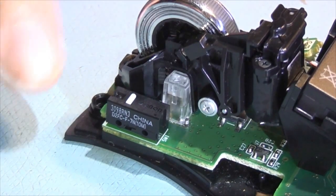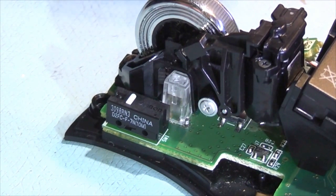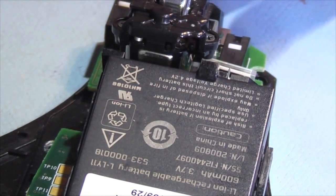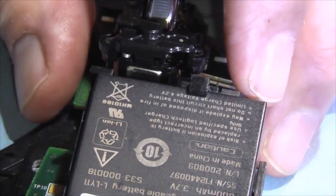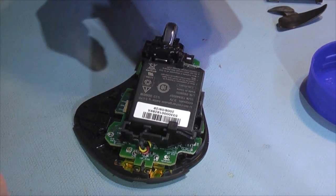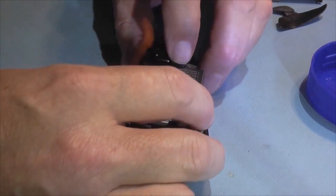So Therion, that's all you do for cleaning the switch. Now I'll move on to switch replacement. If you've got double-click problems, you can just replace the switch and be done with it. The switches are actually cheaper than the switch cleaner.